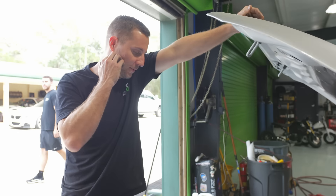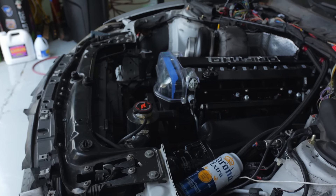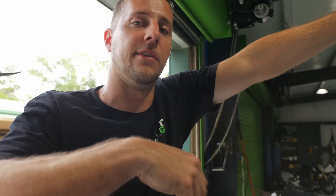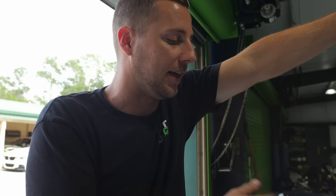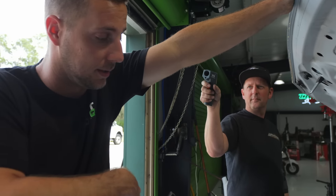We're back on this one - our Polish guy Adam is coming back this week. We found out when it was on the dyno that our oil pressure was maxing out our sensors - I don't know actually how high it was getting but it was too high. With these pumps they come with a pressure relief spring, and when you get the Powerhouse Racing ones there is the spring and then a washer. As we've done before, we always tend to remove the pump housings and put a bunch of oil in there. I think the relief plunger is actually stuck in this one. So I'm going to pull everything off the front of the engine.